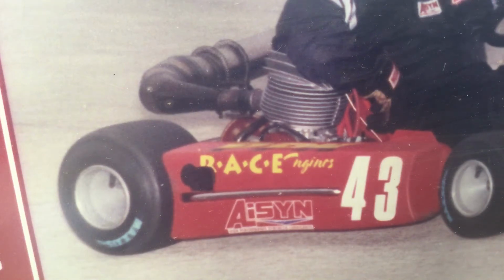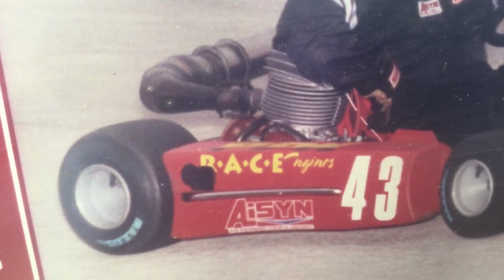So yes, it's going to say it's for top end, low end. All it's doing, guys, is changing where the power band is a little bit. It's not giving you any more performance overall. You're actually taking away, because that motor is ported to come in at its proper RPMs, where it starts its power curve, its torque curve. Anyway, let's move on.